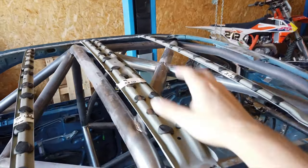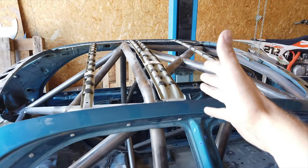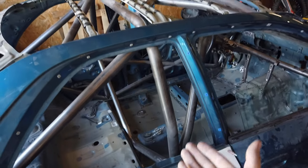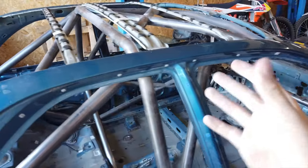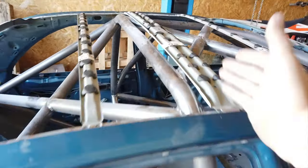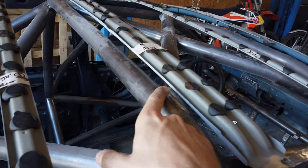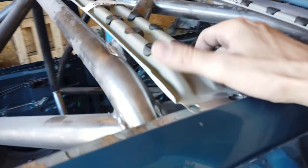I've just got the three supports on here and as I feared, that middle support actually touches the roll cage right there. So it doesn't fit perfectly yet, but it's not a big deal and it can be fixed. I do want to mention this is my fault in a sense, because I pushed the main hoop as far up as I can inside the car — it's actually touching the frame here. That's my choice because I'm a tall person and I wanted to give people inside the car as much head clearance as possible. The front barely clears this beam, so only the rear has to be adapted, and it's really easily done with just a grinder — take a few millimeters off and it will sit properly.